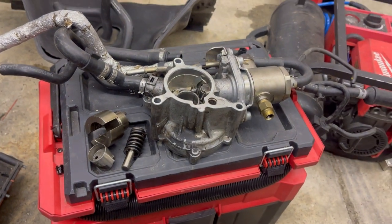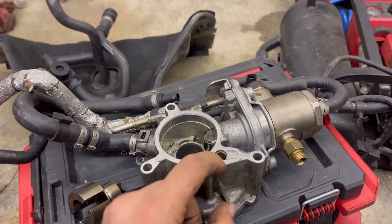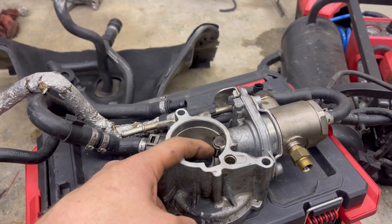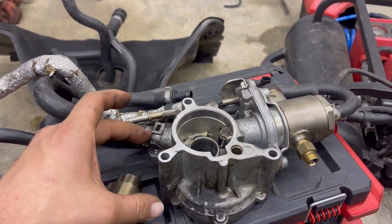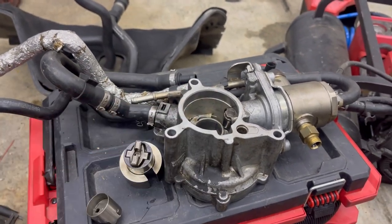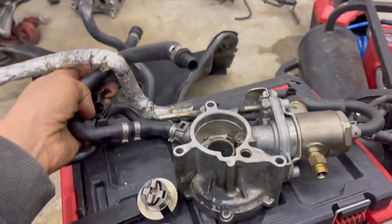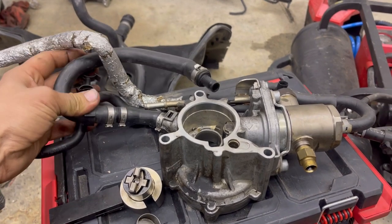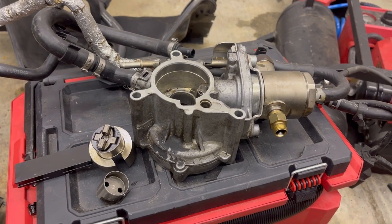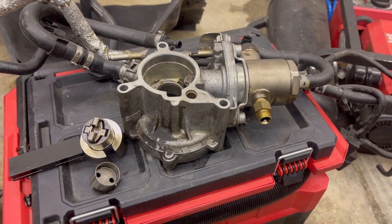For my performance build, I want to block off the oil pressure feed to this and figure out a different oiling solution for my high pressure fuel pump. I want to delete the vacuum pump entirely - take out this big heavy piece of metal and the vacuum pump system on the backside. I want to run my vacuum booster off engine vacuum traditionally. I've got some other modifications too, but you'll have to watch and see. Naptown Tuner - go ahead and subscribe.